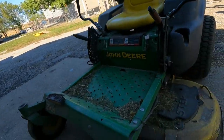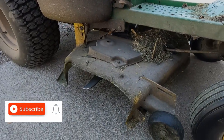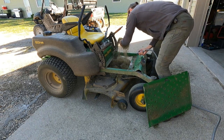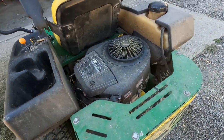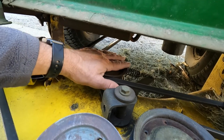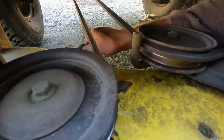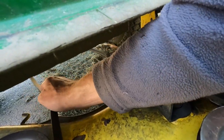The first thing I'm going to do is clean the mower deck off — I have a bunch of grass and stuff collected on it. I'm going to clean it off because I believe I'm going to take the deck off to get to the nuts for the spindles. The first thing we have to do is release the pulley underneath — this keeps the drive belt tight. There's a spring right here, and I'm going to take the spring off to release the tension and let that belt come loose from the drive pulley in the back.